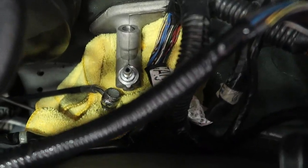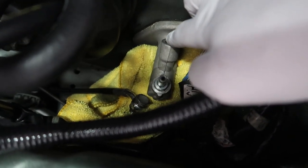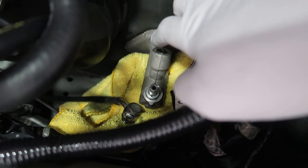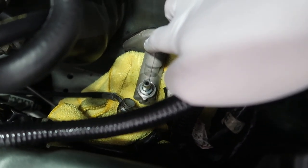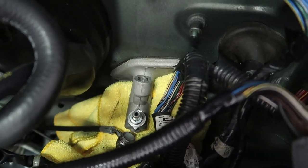It just comes right out, really easy, but it is really tight especially in the engine bay since running so much stuff in there. With a bad clutch master cylinder you do have kind of bad clutch engagement — it was like thudding because of the rod. I took out the reservoir and with the vacuum pump I like sucking all the fluid out so when you take out the master nothing spills. Make sure you don't lose the copper washers if you're running any clutch line. To go inside and take it out, you want to remove this cotter pin — I normally flip the cotter pin around.